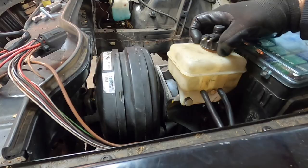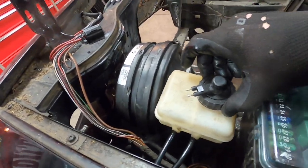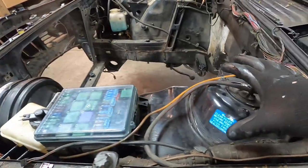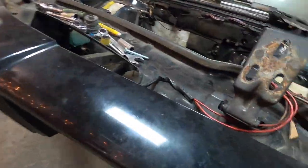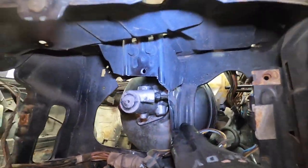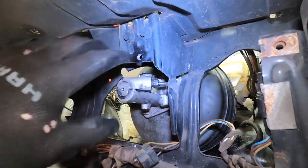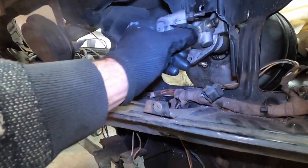I'd like to create a bracket that welds right off of this steel bracket right here, allowing me to install the reservoir right in that location. It's right next to the fuse box and right next to the power steering reservoir, so everything will be located on this little area right above the driver's side wheel housing. As for the brake master cylinder — there it is, it's loose — but there is room for it. I had to make a couple of notches out by the hood latch and behind the headlight bracket in order to make room for the brake lines. Right now, this has a good, clear, easy way to remove and install.